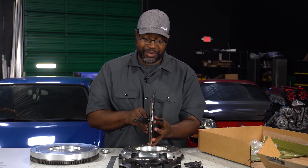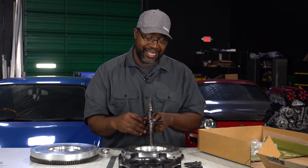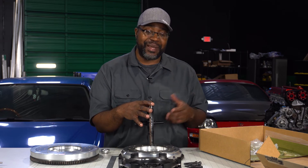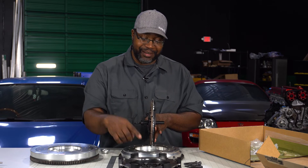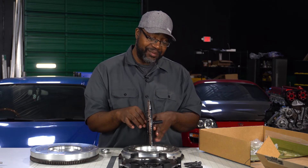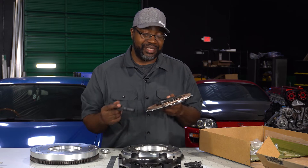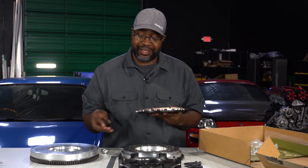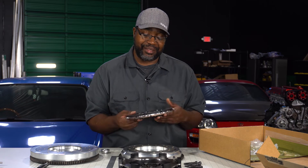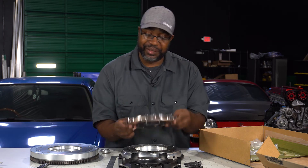Clutch Masters made this change recently. Before, guys would not push the alignment tool all the way through, and when trying to install the transmission the input shaft would naturally go through the first disc and then snag on the second disc. Guys would force it on, try to pull it on with bolts, and end up bowing the second disc. Then on the dyno the clutch would start slipping — and when you'd take it apart, the telltale sign was uneven wear all the way around the friction pad on the flywheel side disc. That singular hub saves guys a ton of issues during install. Since it's all modular, the floater is tabbed out for the feet so it doesn't matter how you drop it in there.